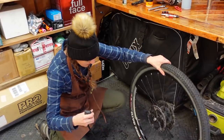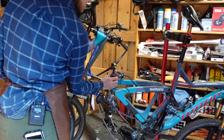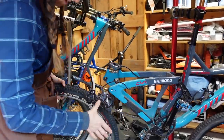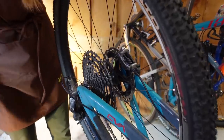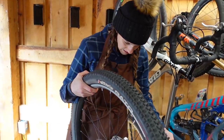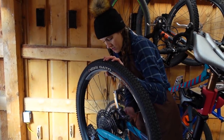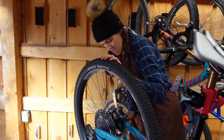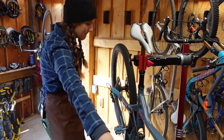This one tells us the pressure. Just use a floor pump, pressure gauge, or whatever your system is. The final step — you put it back on the bicycle, which again is underrated in terms of difficulty. Take out your shim if you used one. Get the chain onto the little chainring. The reason Sid knew it was going to go on the smallest cog was because she shifted into the hardest gear as she was taking it off. If you forget to do that, you can still do it with the wheel off, but always before putting it on, shift it to the hardest gear. And put your clutch back on. This is a great opportunity to adjust your derailleur if it needs it, and lube your chain — we have videos for all these things.